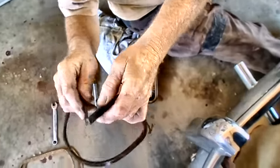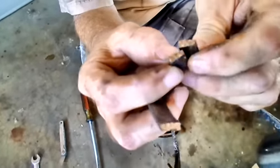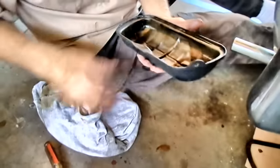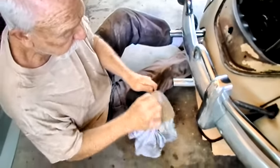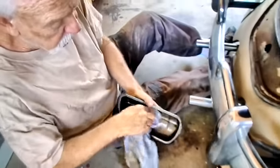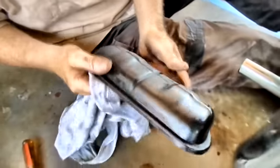Obviously mine's been running pretty cool here. If yours is really a crispy critter, it could take 5-10 minutes by hand to really get it out. You can use carburetor cleaner, or hot tank it — just dip it in. I like to clean these all off real good. You get to see your oil in there and the condition it's in. Nice and clean in here — no sludge, no grit, no dirt. Sludge particularly means your oil is not being changed enough. It should always be nice and clean.